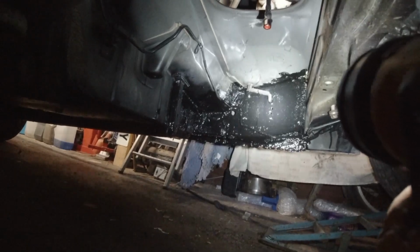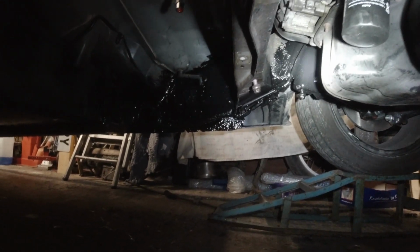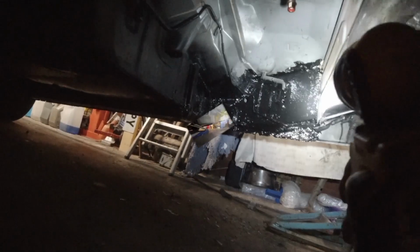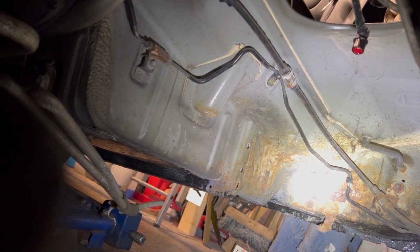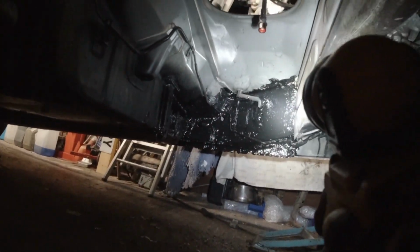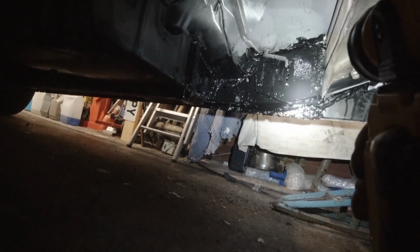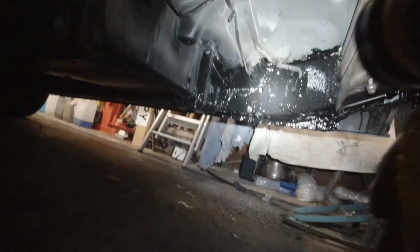We've also done all the repairs under the car here. We've rubbed it back down to bare metal. We've had the angle grinder under here and everything. What we need to do is, there's a load of surface rust up there. I can now get to that with the fuel tank out, take that bracket off that's hanging down, clean all this back to bare metal and treat it. Again, I'll put a clip of what this looked like last night. That's now had its 4th or 5th coat of paint. Very thin coats every time. And that can dry now, that's done.